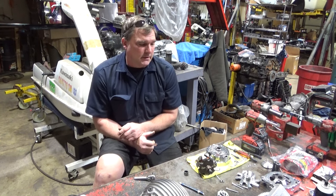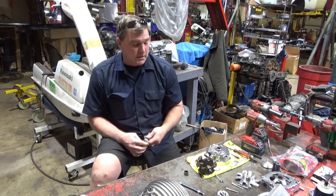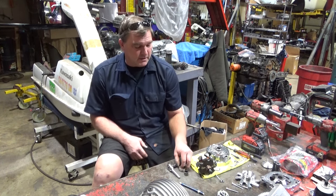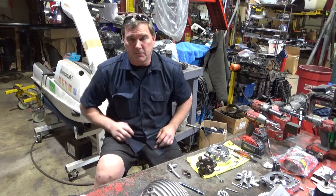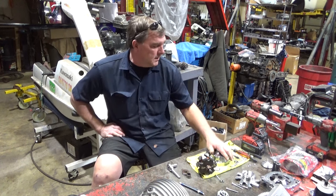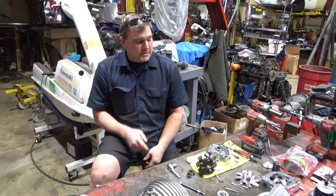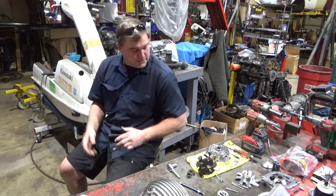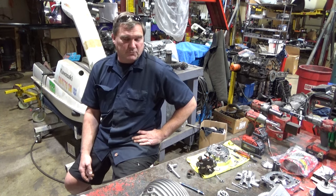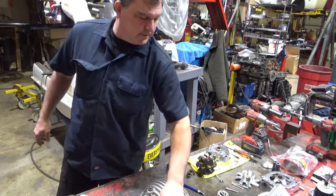We've got pretty nice weather here. I'm sorry to hear you guys in California are getting hammered with hurricane force winds — hopefully you'll make it through this winter and move on to bigger and better things. Maybe Lake Mead will fill back up with all that rain. Electrolysis was the cause of our failure on this brand new alternator — because it was not grounded. So make sure you ground your alternator cases. I'm going to go get some lunch, then put something else back together, because that's what I do. Click like, subscribe, thanks for watching. See you guys on the next one — stay safe out there, keep on trekking! That's actually a really nice alternator. Bummer.